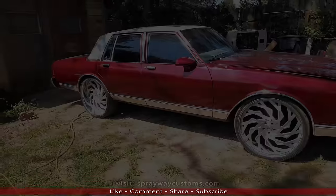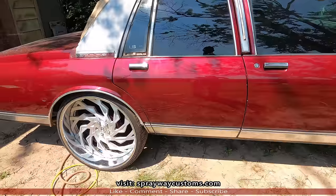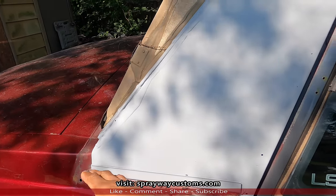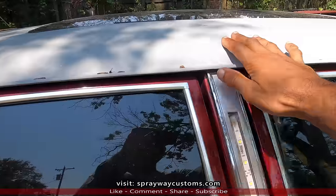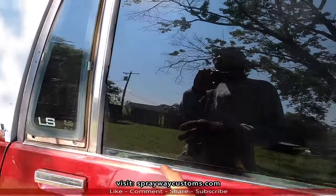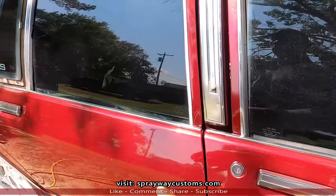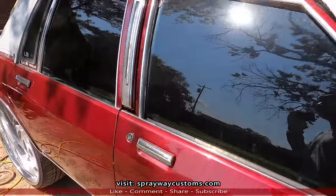The next day, it's gonna be a video of me reviewing the Vevor inflatable paint booth, also the Vevor spray gun. And what I'm gonna be doing to review it, I'm gonna paint this top here. See, I got a cutoff line because it's a quarter top, so it's gonna be a cutoff line you're not gonna be able to see. I'm gonna paint this at one time, then I'm gonna paint the rest of the car later on down the line. But I was thinking about, well, I got this door locked, painting the jambs when I paint this top. I think that's gonna be the plan. And I'm gonna have to remove the doors. So we're gonna be removing the doors and scuffing everything up, getting ready for paint. So y'all stay tuned. Let me get everything set up and we'll get started.